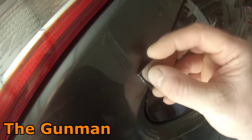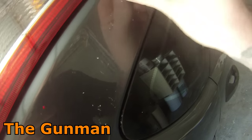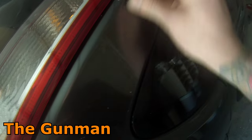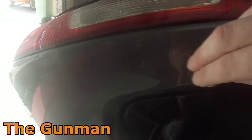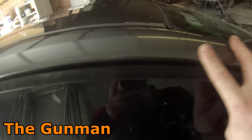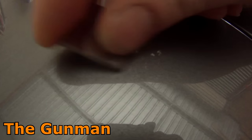This is a bit of a blend area - I had a few little bits of dust land in there, which isn't uncommon. You've got to be careful when doing blend areas that you don't cut through and sand too much. If you've put color over the blend when painting, when you start polishing you'll always see a little bit of a peel-back area. It's not ideal but it saves the owner four or five hundred dollars and makes the job a little bit smaller without compromising quality too much.